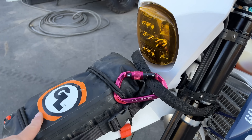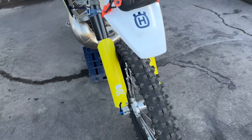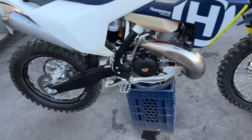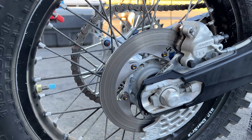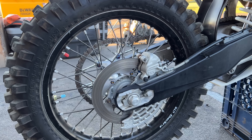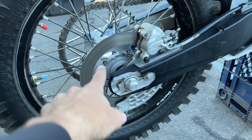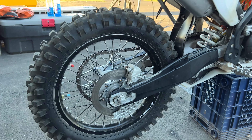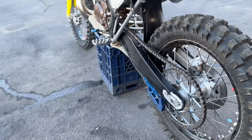Grabbers on the front. Giant loop tank bag that just has fuel in it. Upgraded the brakes to a solid rear disc — it's so steep and treacherous up there that I've had brakes overheat and cook before. So I went to a solid disc with titanium bolts and solid steel sprockets. The sprockets and chain are much tougher than what I had before.